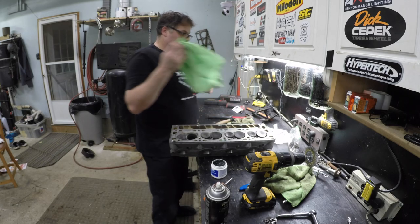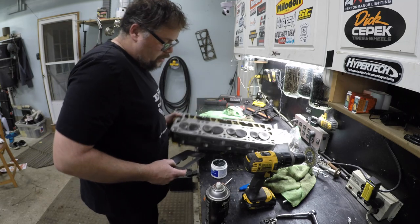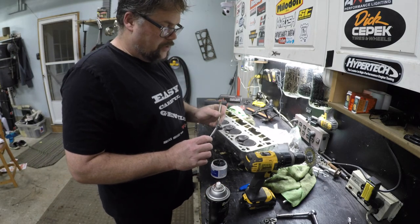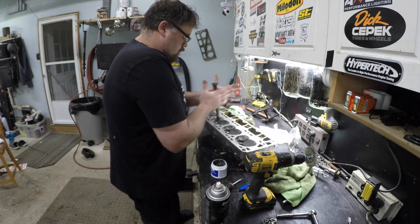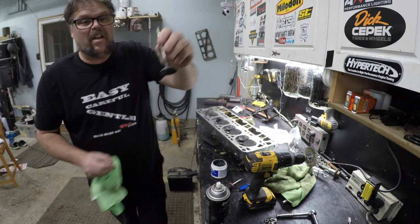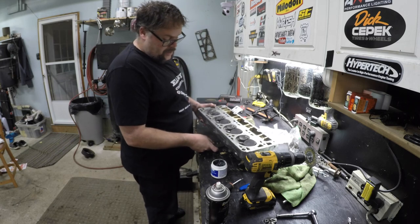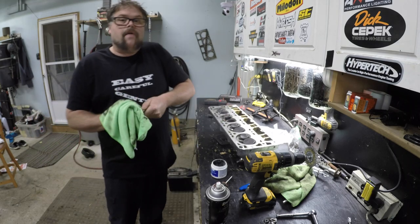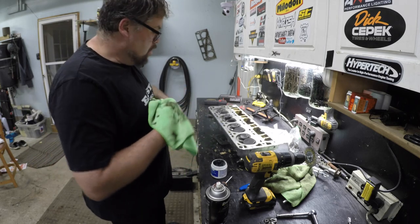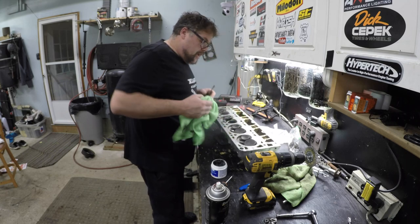Let's take a gander — just like I said, these aren't that bad. That one looks a bit of a dicker — I'll show you before and after. Watch how good it looks after. Somebody commented in the last video to put more lapping compound on it — it actually works faster, and they're 100% right. I wasn't putting enough on the last ones, that's why it was taking so long. These ones are lapping a lot quicker with a little extra compound — don't be afraid to use that stuff. It's making a difference.